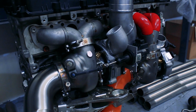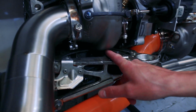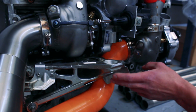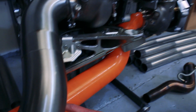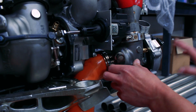We've got some clearance. It's not as much clearance as you'd like to have, but that's almost never going to happen. There are going to be compromises in having two really big turbos where once before two really small turbos sat. But we've got clearance on the engine mount. Again, not a lot. We've got basically no clearance between the turbine housing and the engine mount here, and then the same on the compressor cover. No real clearance there. This is a little shroud which covers the rubber engine mount, so we need to keep that because it's a bit of a heat shield. But you can see the downpipe clears. This ICE Engine Works plastic downpipe we've got at the minute is super close to the compressor cover on this side. Again, I can't really move this turbo any further forward, and I can't move this one any further back. So this is where we're stuck with them.